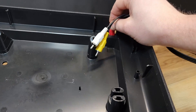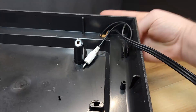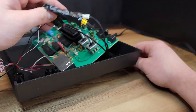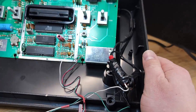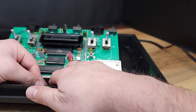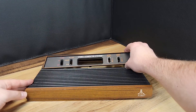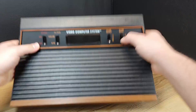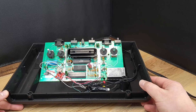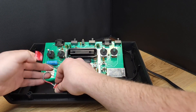The new cables can be fed through the port previously used for the RF connection. Luckily, there is plenty of spare room within the case to neatly route the wires and store the excess. Now we can reinsert the switch bezel and click it back into place, as well as install the four switch dust covers. Here I'll secure the mod board to the case via the 3M double-sided tape provided with the kit.